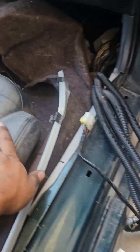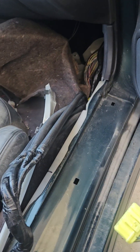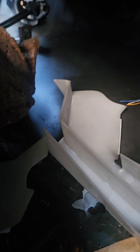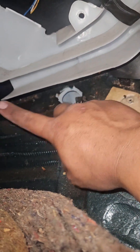Harness is partially pulled out — what a complete pain in the ass. So this is the ECU side of it. There's a connector that sits underneath the center console here, and one also on the other side of the center console. This wire is grounded to the center console and runs across this little plastic piece. That plastic piece sits against this corner, but there's a metal frame underneath with about four screws. You remove that whole plate and this harness makes it out.